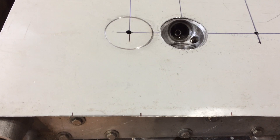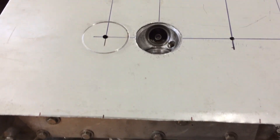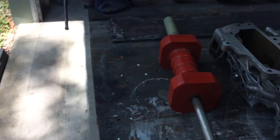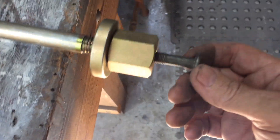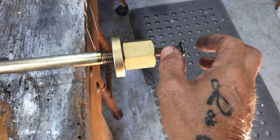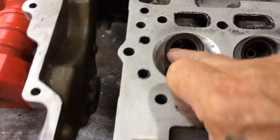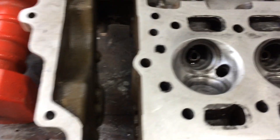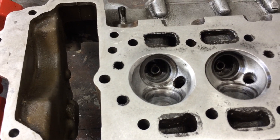A little cover plate — I was going to put four holes, but I only really need one. I've made this little thing here to go on the end of the slide hammer. I just cut the end off — it had a long head, so I've just cut it off. I'm just hoping that I can weld some blobs onto here and it'll pop out. With the heat of the welder, it should help it pop out.